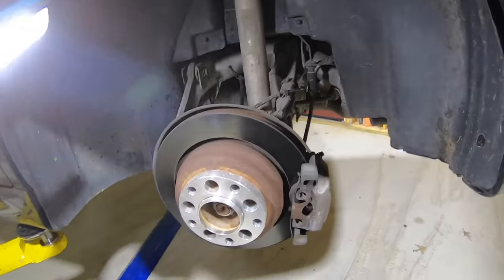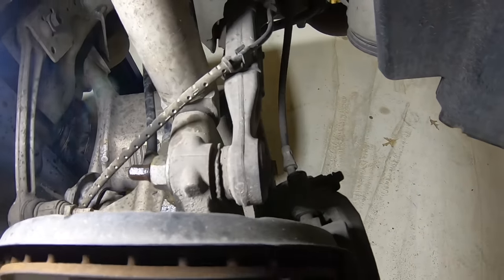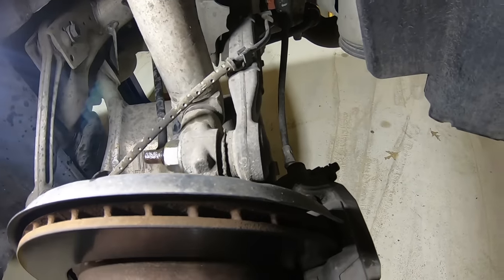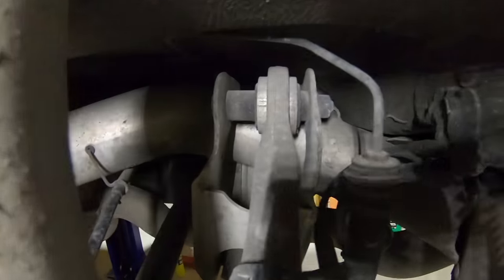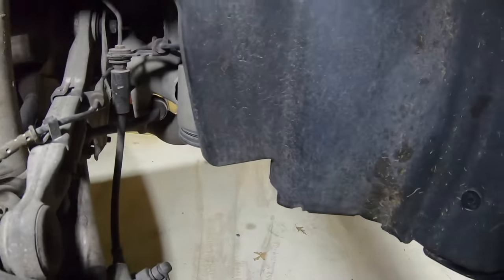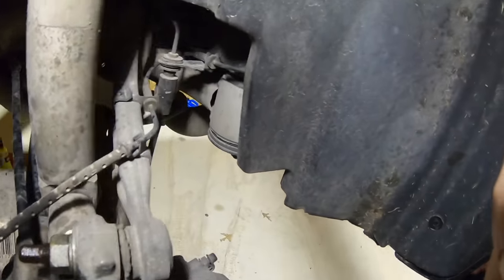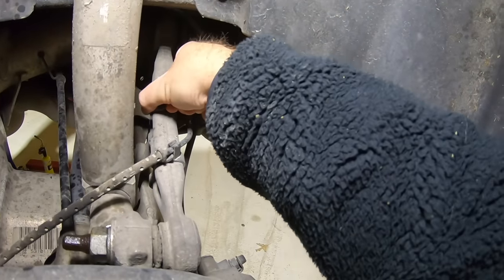So here's the basic situation: we got a 22mm bolt on the ball joint. Come back to that in a second. Then you've got two 18mm bolts back there to take the through bolt and nut off — that's not too bad. The GoPro gets right in there. But I don't have enough hands — these have little latches.